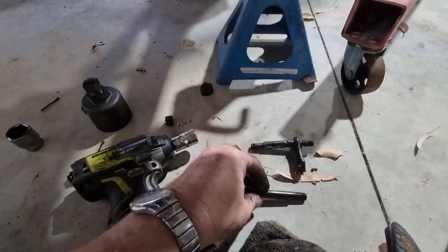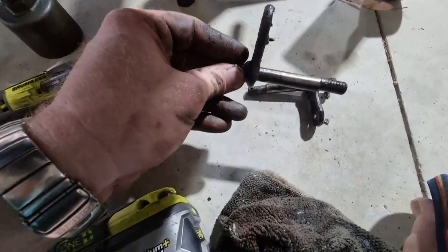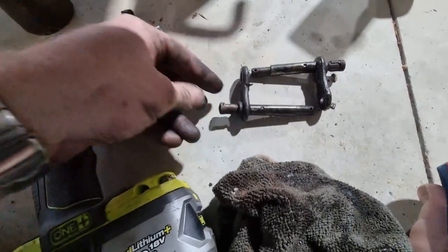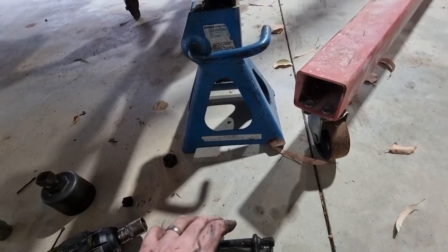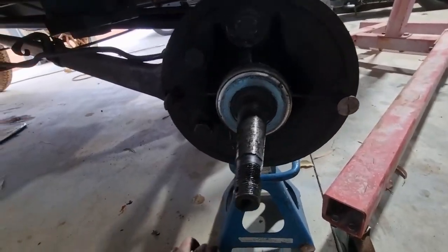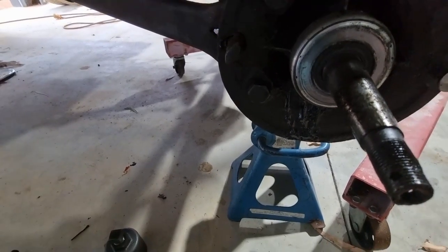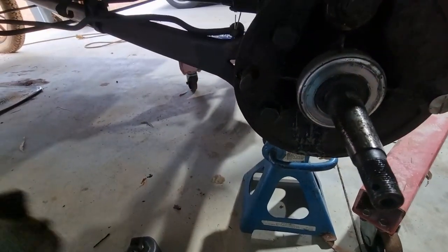Here's the other side — sorry about the lighting and the leads and the start of a storm. These actually look reasonably good. The bottom one was a bit dry, but it could be dry because I didn't notice it does have an oiler — it was sort of hidden from view because it faces this way, tucked in behind there. Now I know, I'll make sure it gets properly lubricated and drop those in the parts cleaner. Same story here though — no cotter pin. I also have to get this brake rod off and these two radius arm bolts.